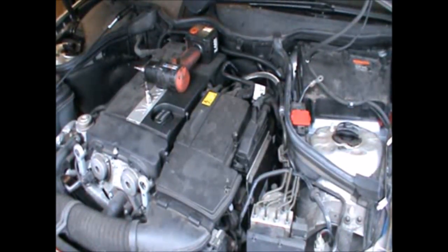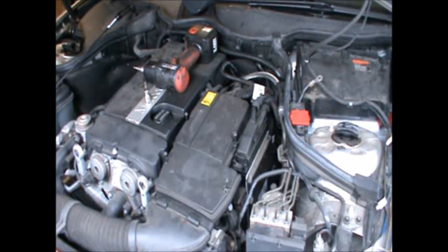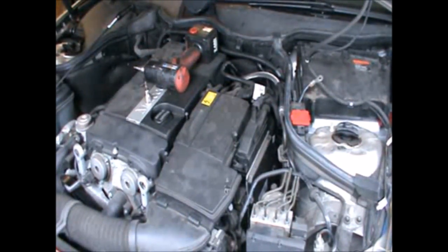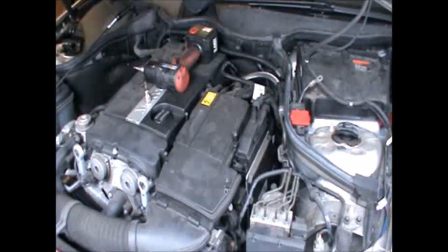And the reason for that is because the engine light has come on and we have a fault code stating the vehicle is on a lean condition. Now this is a very common fault code which relates to these hoses normally. So that's the first part that we're going to be tackling to hopefully sort the fault codes.